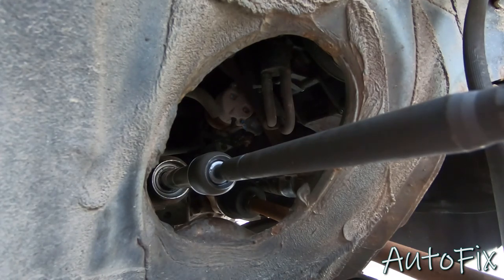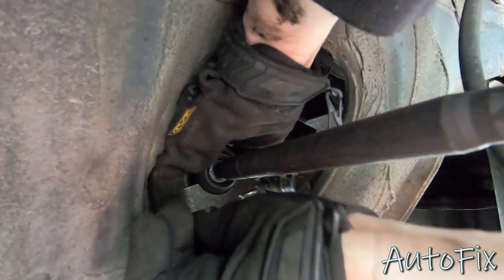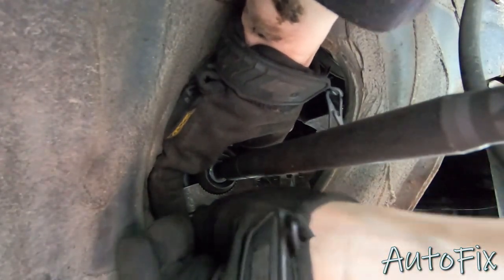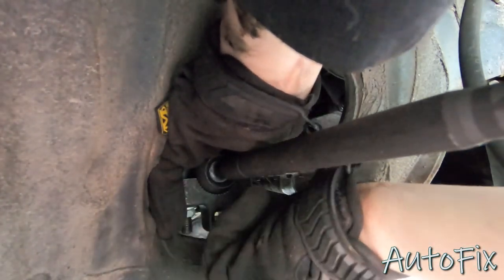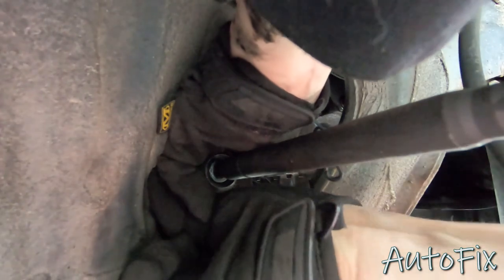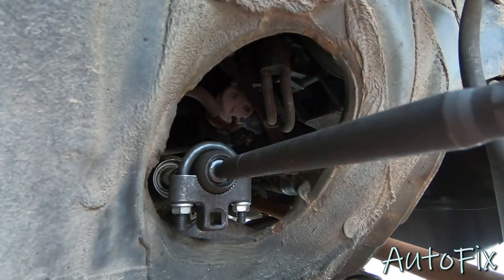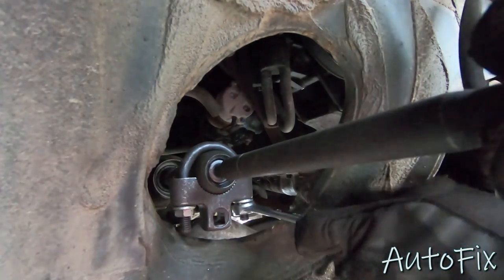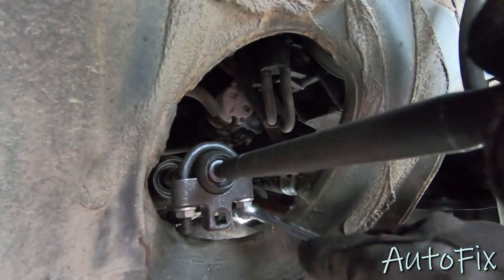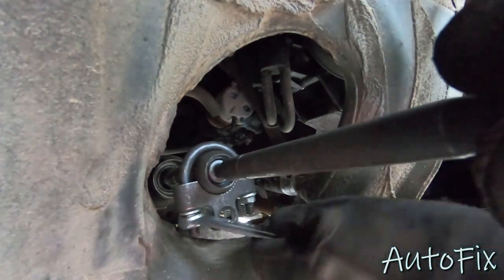So now remove the jam nut off of here, and we'll get the tool. Now I'm sure there's a torque spec to this, and I'll put it down in the description if I find it, but basically I'm just gonna make it tight. And you don't wanna make it super tight because you do have that locking clip, and also you wanna be careful of the steering rack. Like I said before, when you're removing it, you don't wanna put a lot of pressure on it, so just be mindful of that. But again, if you prefer to use torque specs, I will put them down in the description for you so you can have access.